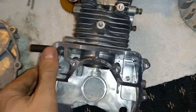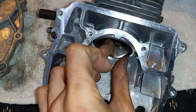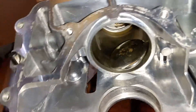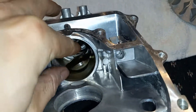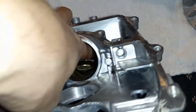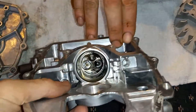This blew my mind — that's a cast iron bore. I got a magnet right here and it's sticking. That is a cast iron insert. So for people that hate on these little engines, they've got nothing to hate about, because their precious two-strokes don't come with a cast iron bore — unless you do a chainsaw jug or a Minarelli.